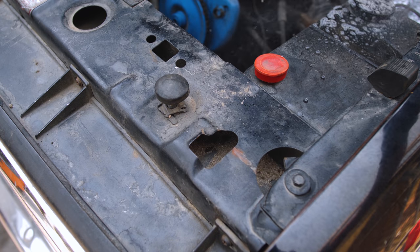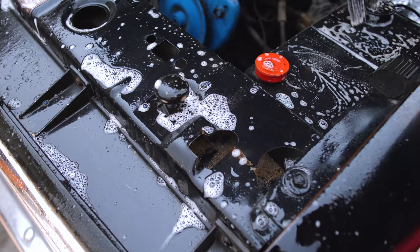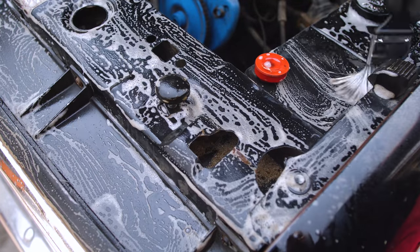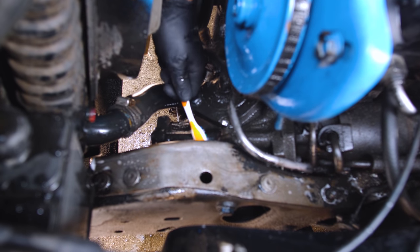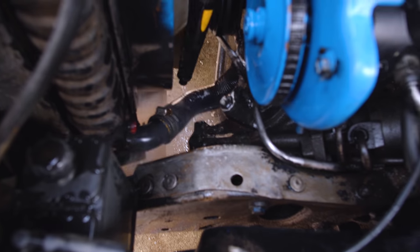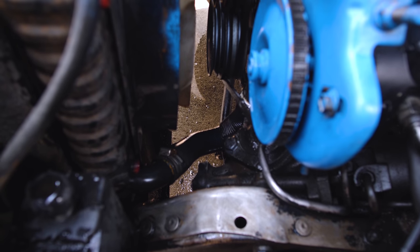Once you clean the top part, we're ready to clean the bottom. Choose a side and work your way around. Simply spray some degreaser over the area and work the product with your brush. Don't worry if you wet the area — this is a light mist and will not damage anything. For hard-to-reach areas, use a small brush to get into those tight spots. After you scrub the surface, rinse off the dirt with water or steam — either one will work. Once you scrub and rinse off all non-sensitive areas, you're ready for the next step.